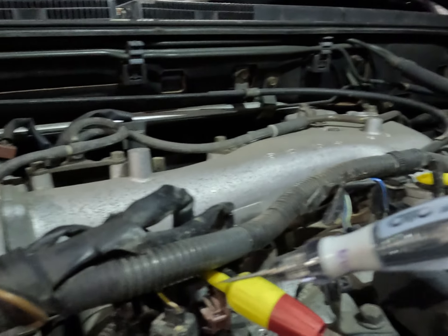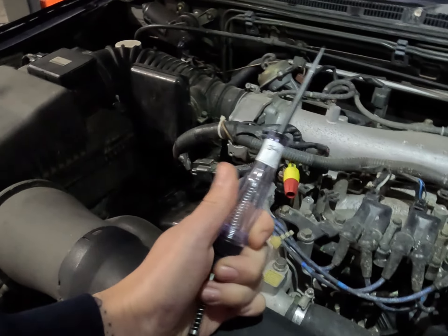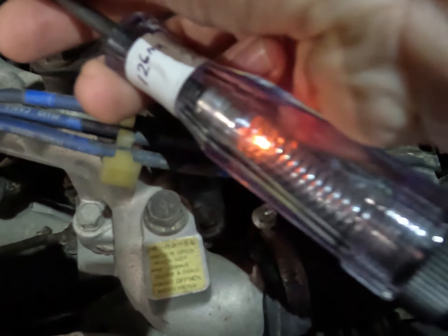Simple circuit design. We know we've got no output to this coil — we've checked it at this ignition module. All we need to confirm now is that our ECU transistor is grounding that wire. If we hook up our low-amp test light to that, as you can see it is flickering. This is a 126 milliamp test light — it is important to know what your test light draws, because if you put a bigger test light on this circuit you will end up killing that transistor in the ECU.